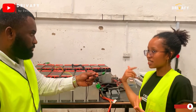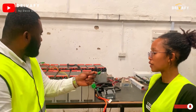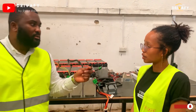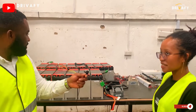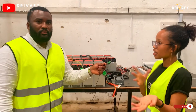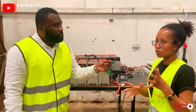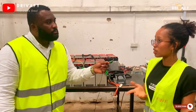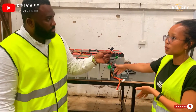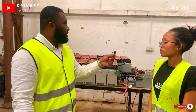How many of these battery modules would you need for, let's say, a saloon car if I were to convert it to electric? These are quite large, so we wouldn't put these in a saloon car — there are smaller ones depending on the energy demand. For example, the Land Cruisers we've converted use a 38 kilowatt hour system with 36 battery modules but smaller in size. For smaller spaces we recommend fewer, smaller battery modules.